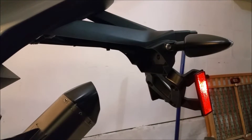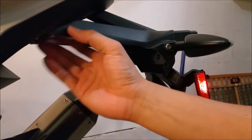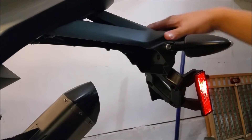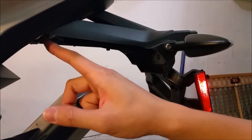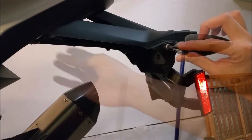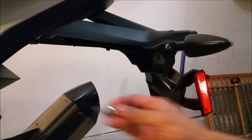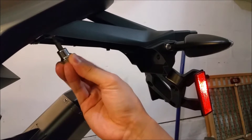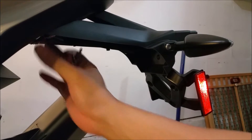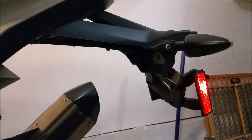So we're going to get started by removing this whole fender assembly. It's held on by Torx bolts as we've already established. The top one looks like a T30. Let's look at the bottom ones — those are T25. This one here looks like a T30. So let's do that.